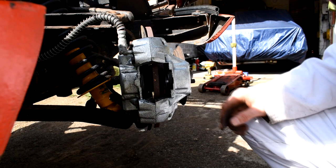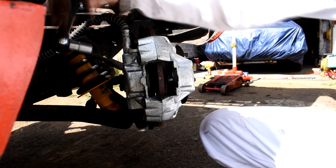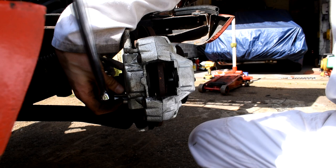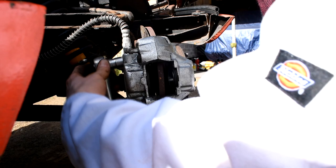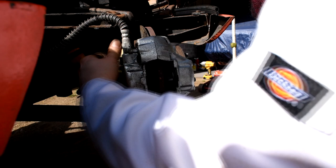And then the next step, because I'm replacing the discs, will be to undo the two mounting bolts for the caliper either side. So there's one there and two there. And then if we just get on it with a ratchet, hopefully it'll all just come apart and we can put the caliper to one side. So there's one there,